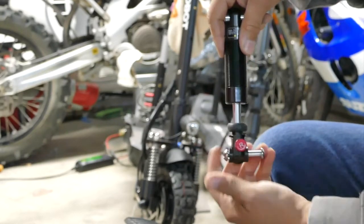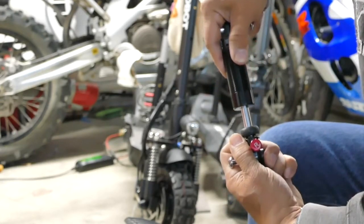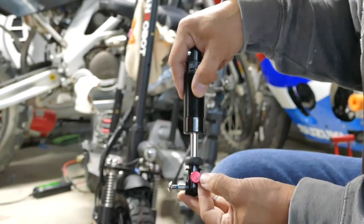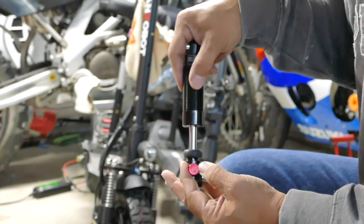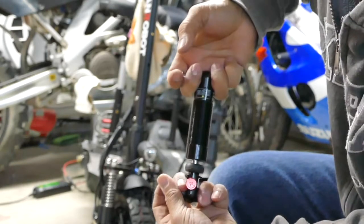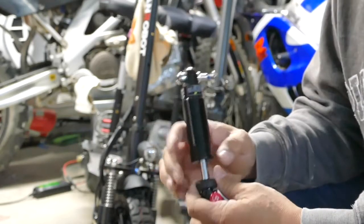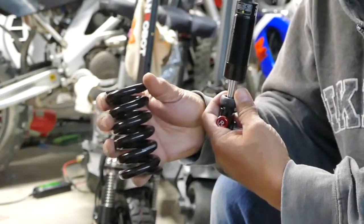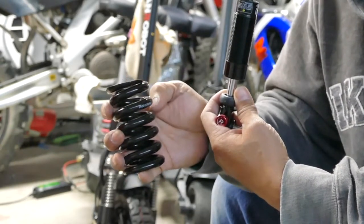If I dial to the positive side, I can pull it apart quite easily. So plus means more springy effect and less dampening on the rebound; minus means less springy effect and more dampening on the rebound — completely backwards. But it does work; the rebound adjustment actually does adjust the rebound. And you're going to need that much force because this is a 1,500 pound per inch spring.